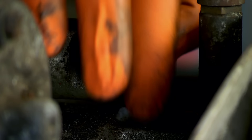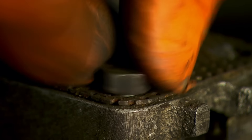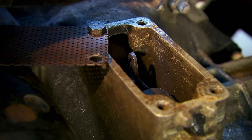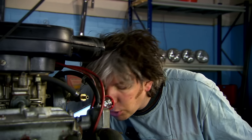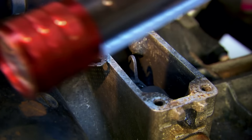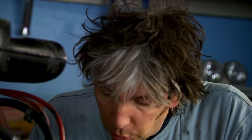As I cut through the hydraulic pipe with a saw, I can see that something seems to be missing from the outside of the clutch slave housing. So I dig inside to see what's going on. There's a kind of a slot, and ordinarily I would expect some kind of spring to be there to reset the clutch slave every time you operate the pedal. By the looks of it, potentially right down inside the bell housing there may well be a spring. The only way to find out is to actually take the gearbox off the engine — and that also makes sense because we should check the condition of the clutch.